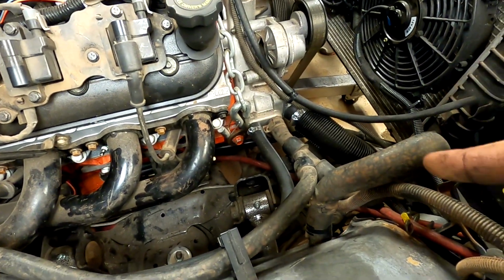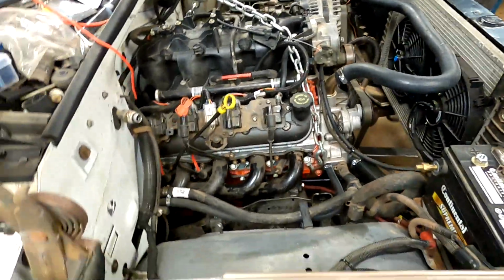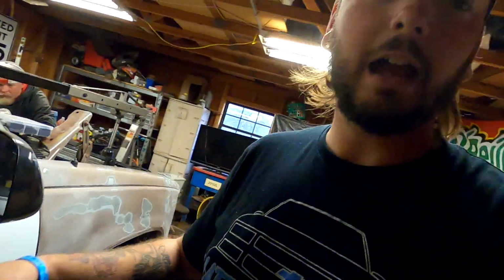We're going to get the clamshell bolts tightened back up. We got to get the nut back on it. They're just slid in right now. So we'll get those tightened back up, and then we're going to get under there and look at our transmission crossmember bolt holes, because there's a bunch of holes in that area. So I'm going to see if I can twist the crossmember 180 or whatever, flip it the other way and see if I can get some holes to line up without having to drill any. But worst case scenario, we'll drill the frame because it's real thin metal. I don't know why GM made it so damn thin back there, but it's thin, so we can just drill another hole through it and put the bolts in, and we're done on that.